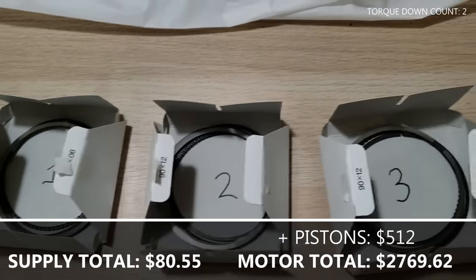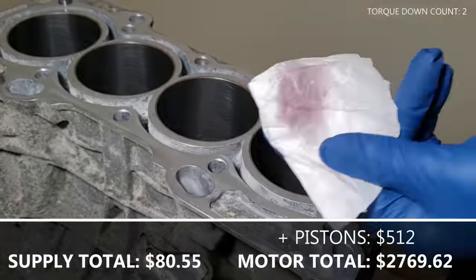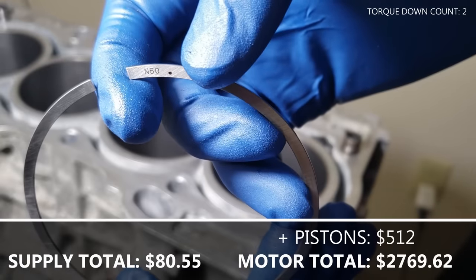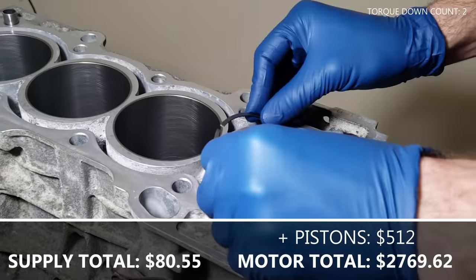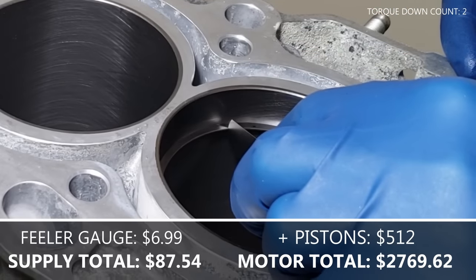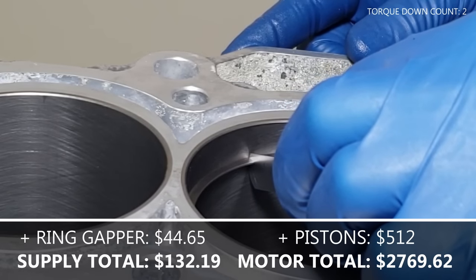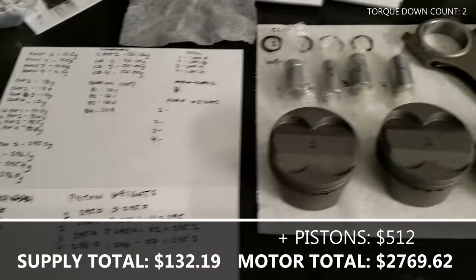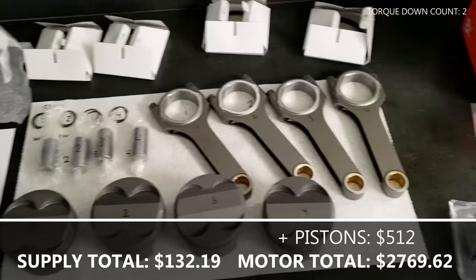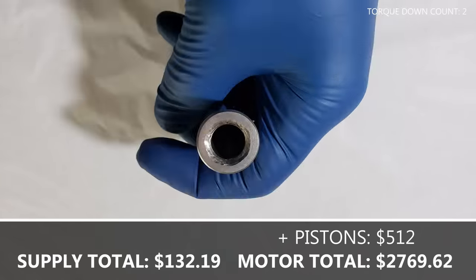Onto the pistons. Separate all your piston rings into specific groups for each cylinder. Clean your cylinder walls and leave a small mark on your piston rings to keep track of which cylinder they're gapped for. Place the ring in the cylinder, use the piston to align it, and check the gap with feeler gauges. Carefully grind the ring down until you reach the gap recommended by the piston manufacturer. Take your entire piston assembly and weigh each part. Use the known weights to balance the assemblies the best you can, then to get a perfect match, grind down parts of the wrist pin.